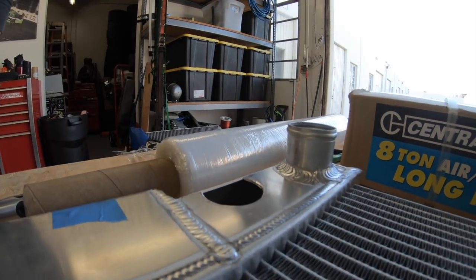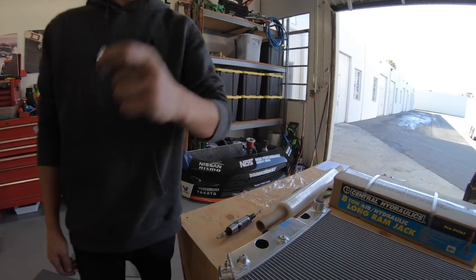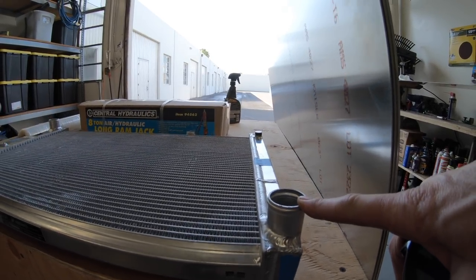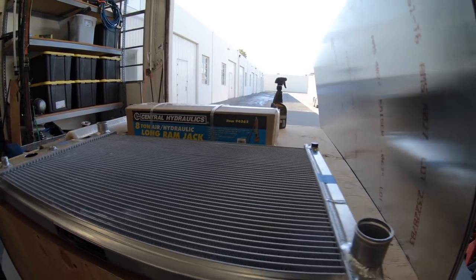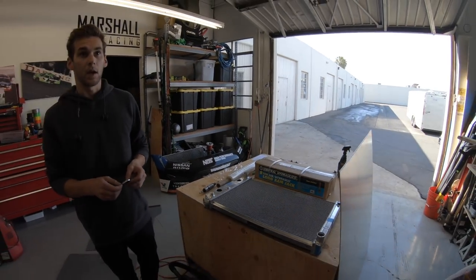I'm going to turn that thing into a D shape and I'm going to weld it all the way across. And I got one more to cut out. Good to go. And it's all plugged up. And like we said, we're going to change these out for the AN fittings later once we get this thing mounted and we figure out if we want to kick a little angle on these up or down, left or right to help with the hose routing. So back to it.